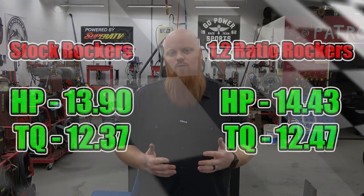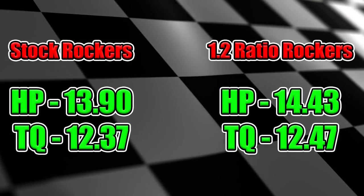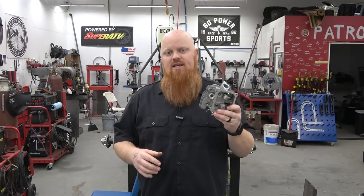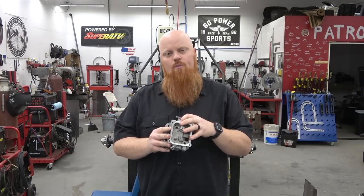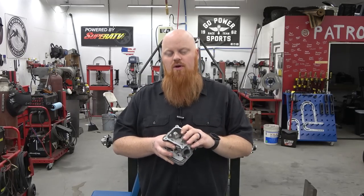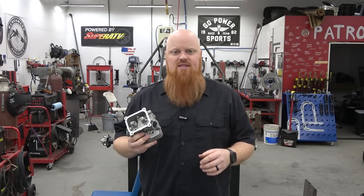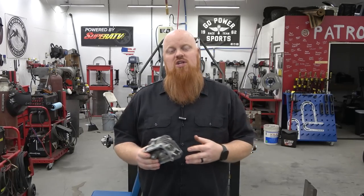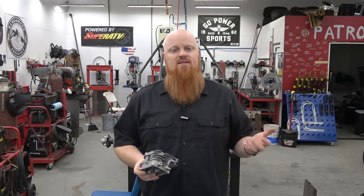All right, so with these ratio rockers, overall we made a half a horsepower more. Now, like I said in this video, we're gonna make a lot more when we port up our head. And I had this stock head sitting on the shelf and I went ahead and did a full port job on it and polished the exhaust side, left the intake side a little bit rough. We're also gonna be installing some stainless valves in the next video. So that should help out flow a ton, which I think is the biggest holdback to this engine right now.